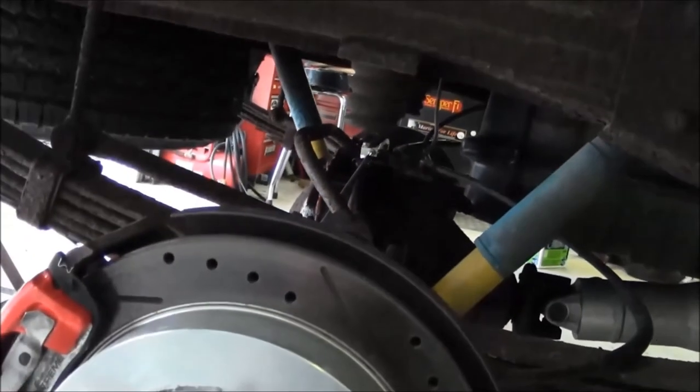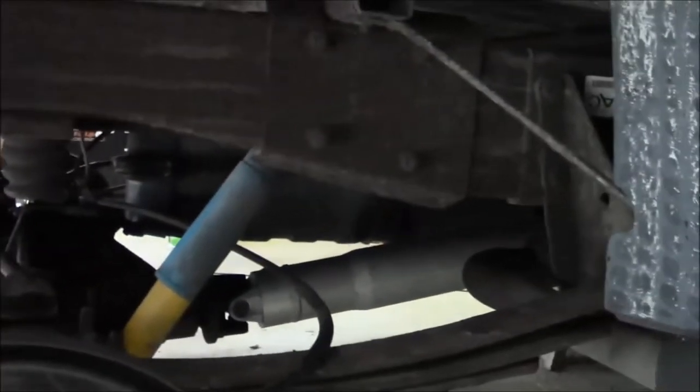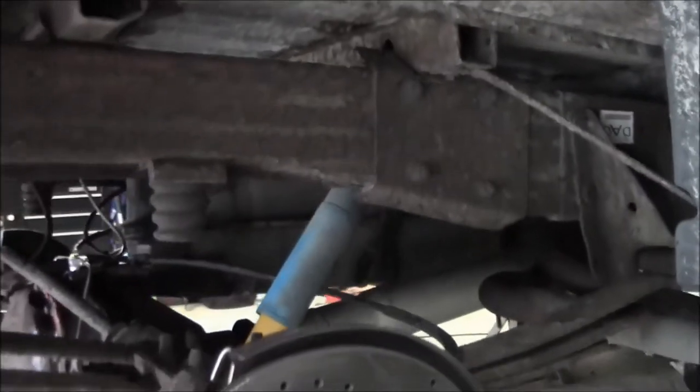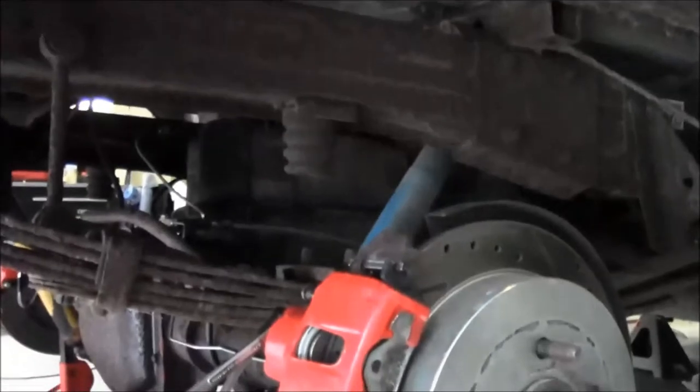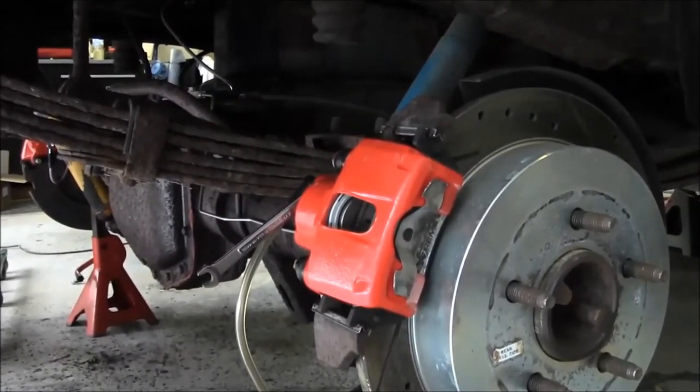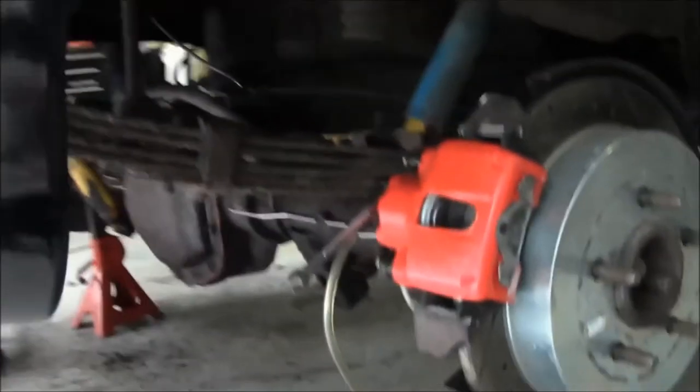Alright, I got that splitter snugged up, just kept snugging it up and then holding pressure on the pedal. We had to do it like 3 times to get it to stop leaking. I think we're good. And then, kind of a good thing, it looks like the ABS is holding steady and the other two unions on that intermediate line look good. The cool thing is if they're leaking, you usually get a huge puddle of brake fluid, so it's pretty easy to spot.